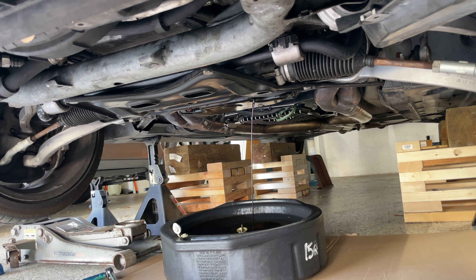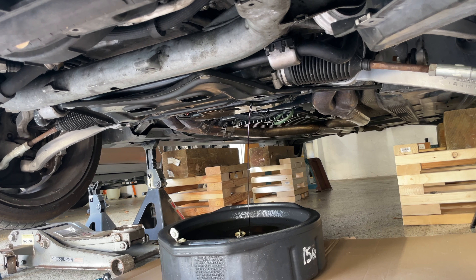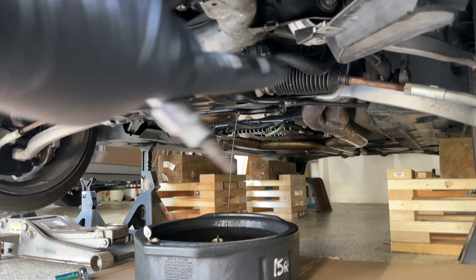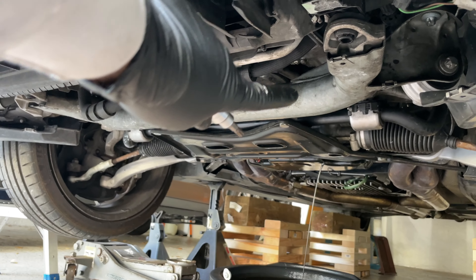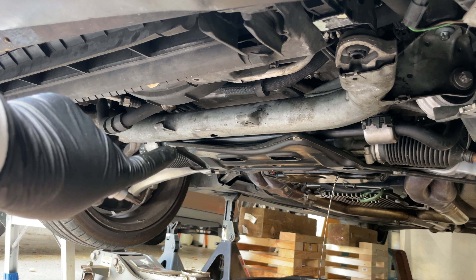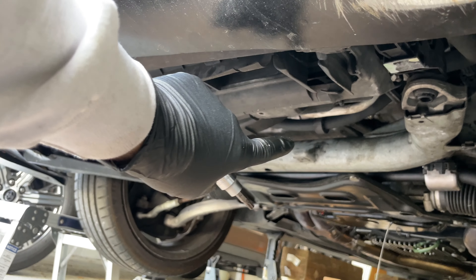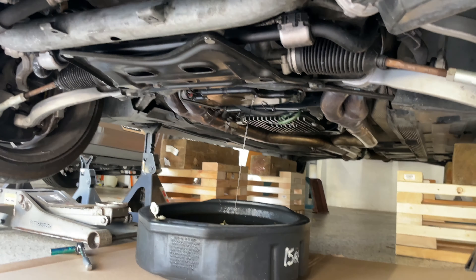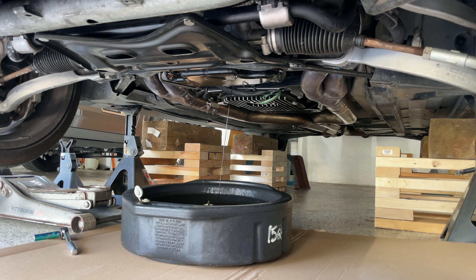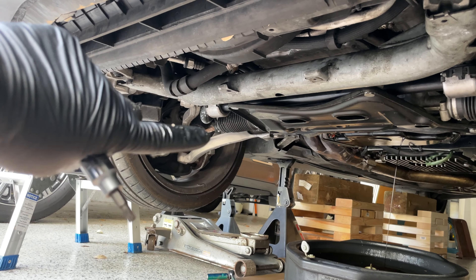The oil is draining out — that's going to be a 13mm drain bolt, just let that drain. I believe it's a T30 and either 14 or maybe 15 bolts holding the lower oil pan on. We're going to take that off next to continue draining all the oil. Then it's going to start with taking off all the supporting stuff: upper and lower control arms, tie rods, power steering rack. This is part of the subframe right here, and then it goes back where we have our engine mounts. And right in there you can start seeing the upper oil pan — all of this has to come out so we can drop it.